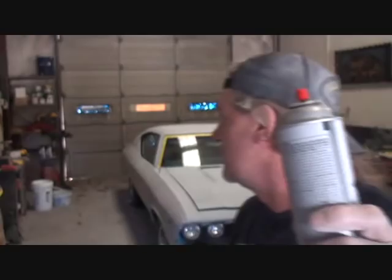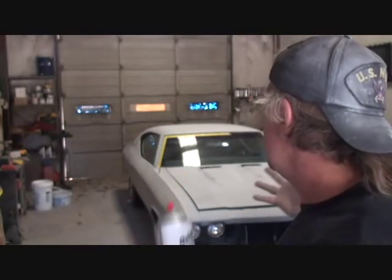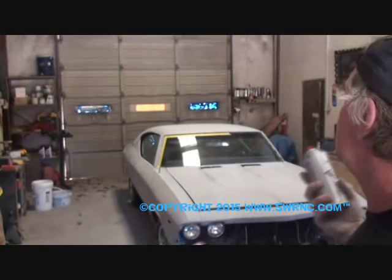So, what we're doing is we are wet sanding the car now. Let's get our guide coat. Once again, I'm going to put a very, very light coat. The only reason I'm doing this, I was rudely interrupted here, is that I am making sure that we cover every section of it. If we sand it without it, we won't know where we stopped sanding or where we did sand. So using the guide coat technique is going to help us keep perspective of saying, I sanded the whole car.